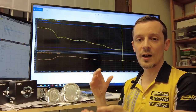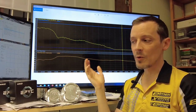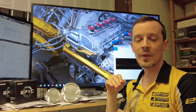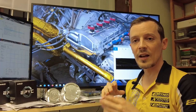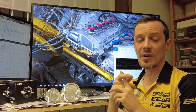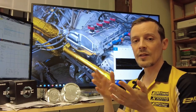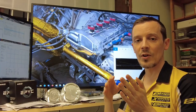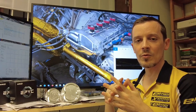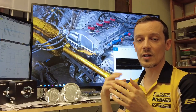When we were helping our customer with this engine on the chassis dyno, we were looking at what theoretical values they were running. We recommended bumping up the fuel pressure to the maximum we could get out of the fuel pump and looking at the injector pulse timing to work optimally. That gained us a 20 percent reduction in fuel consumption and we got around 15 horsepower of additional power.